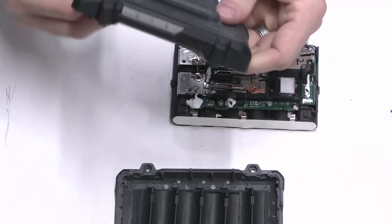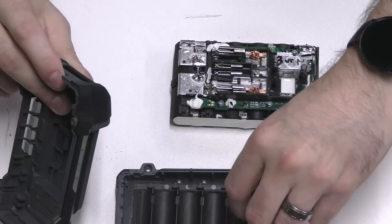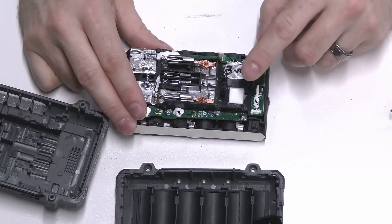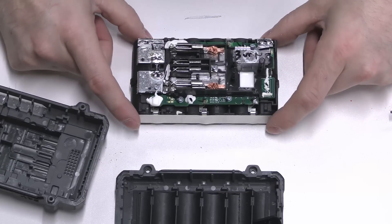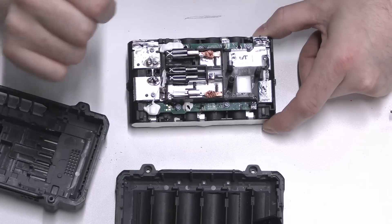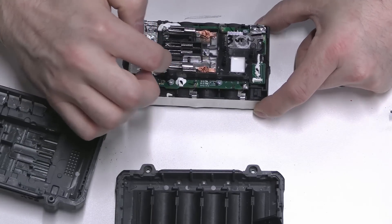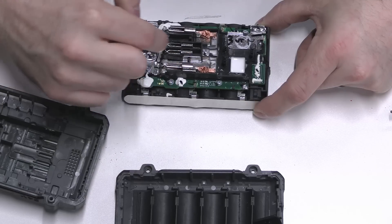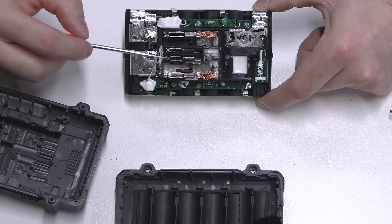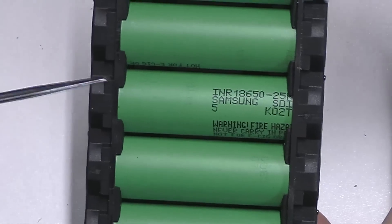And then our top piece. I lost the battery meter button, so we'll put that back in. Here's your spring-loaded battery release button — you've got three springs for that. You can see you have your two primary voltage power contacts with quite a bit of copper — looks like stranded copper wire. You've got your terminals here, these move a little bit, and in the middle are what I assume are the two data terminals for communication between the sensorless brushless motor and this battery.